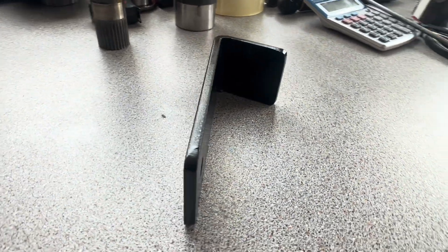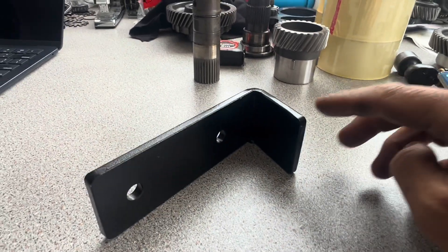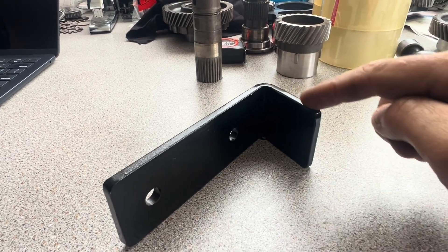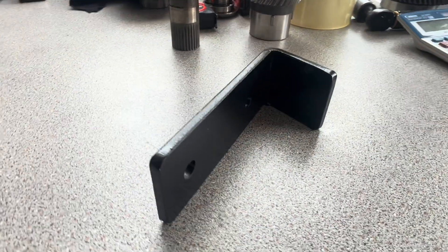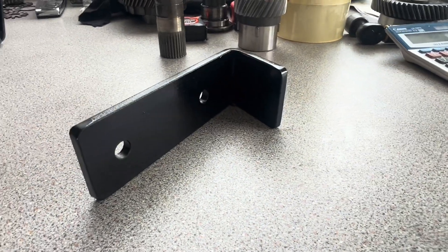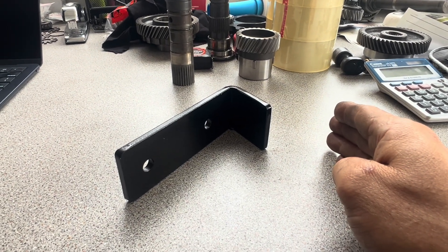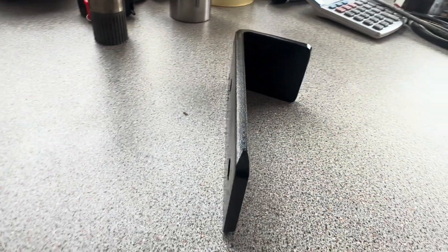So this is the T1 split screen transmission mount bracket. The two holes there are for the two bolts that go into the transmission mount. And then this part here is welded to the torsion bar housing in the rear of your vehicle. So you'd want to get some sandpaper or a flap disc on a grinder and just grind the paint back here and on the other side as well, and maybe across the front face, so this can be welded to the torsion housing. It's very important that this is welded in the correct spot or you won't be able to close your engine lid.